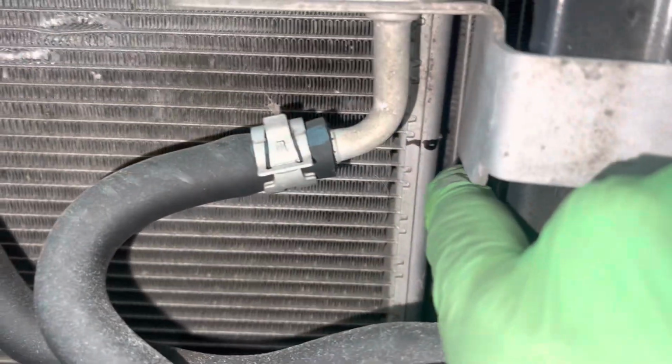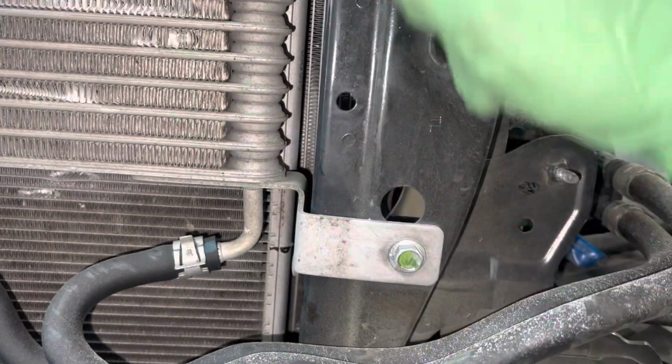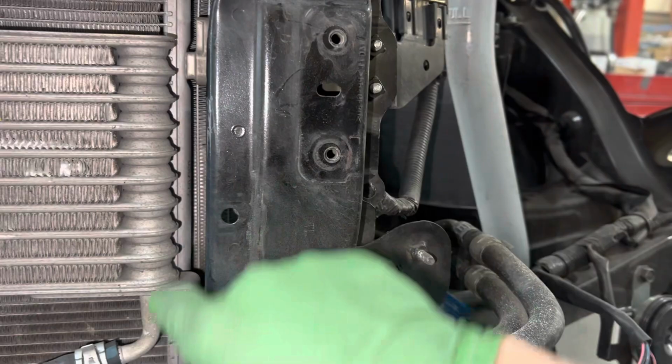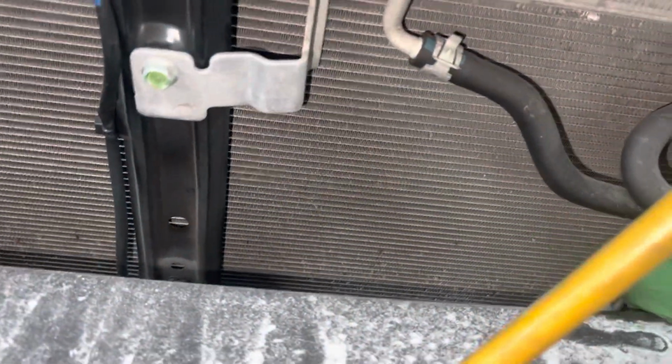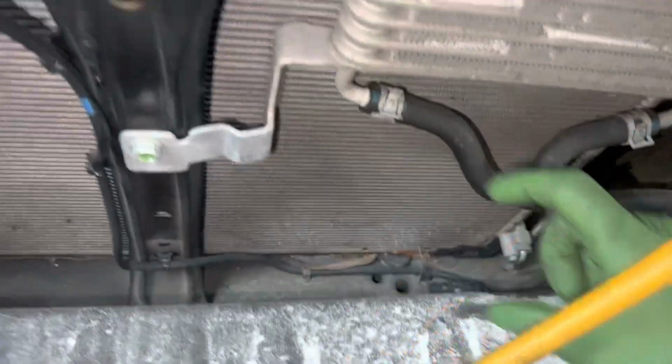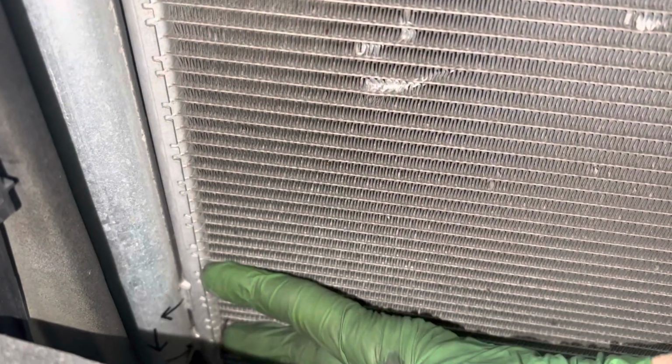Where I have that little black mark, there's a little piece of metal, and that means there's a little plate there that separates this piece. This refrigerant, the hot gas, fills up this header that much, and it takes all these passes going across. Then it drops down, it passes, then it drops down again in a smaller section, and it passes again, and the refrigerant is right here.